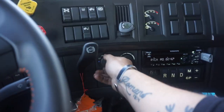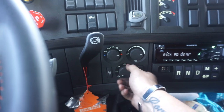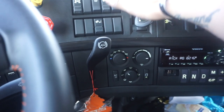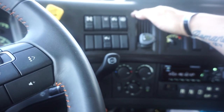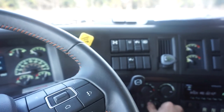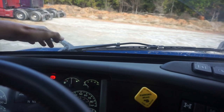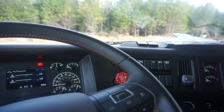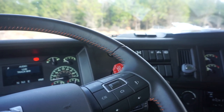Turn on the heater and hold your hand over it. Put your hands on the vent and then on top of the dash at the defroster. You physically want to show them that you're feeling for air. Once you feel air coming out, say it's in proper operating condition.